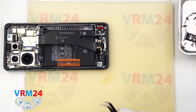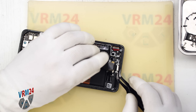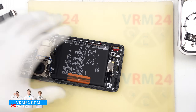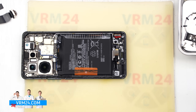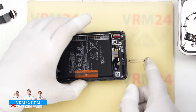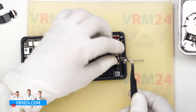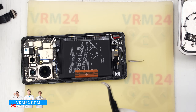As we can see, the interboard cables have arrows indicating the direction to the motherboard. Now a quick test of the microphone opening: the microphone opening is slit-shaped and located in the display frame, while the microphone itself is located on a small board on the opposite side. Accordingly, if we insert something into the microphone opening we will not be able to damage the microphone that way, but liquid might.